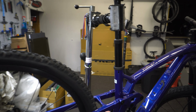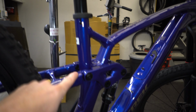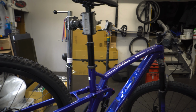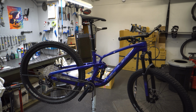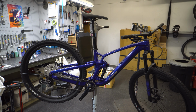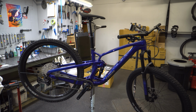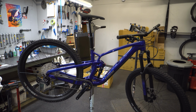You can mullet it, and using their flip chip technology where you flip the suspension and you flip this, it will correct the geometry so it will ride really well and actually tighten up that back end like a proper true mullet. You just can't buy it from the factory stock like that. Not a big deal. It is kind of cool that you can do that, especially with the 2 points of adjustment now. It'll really make a big difference.